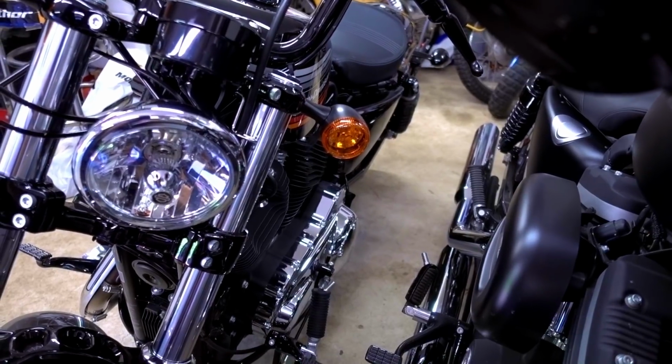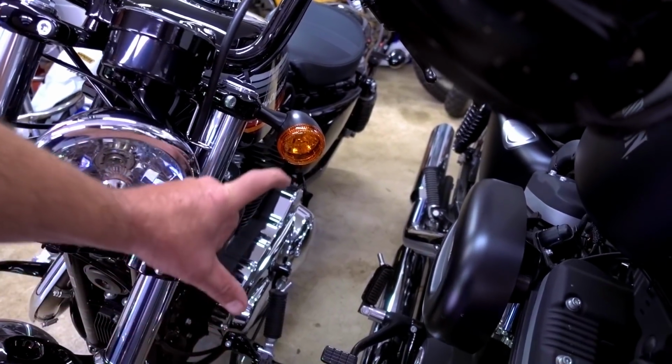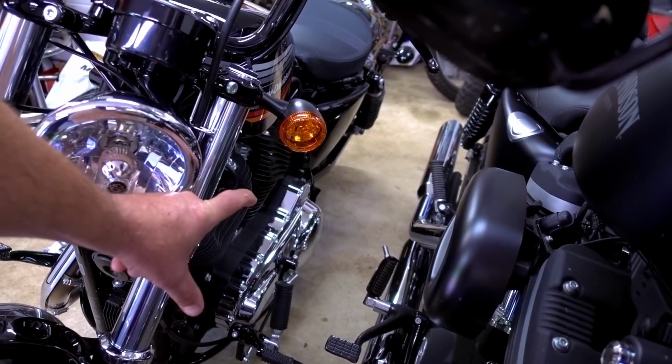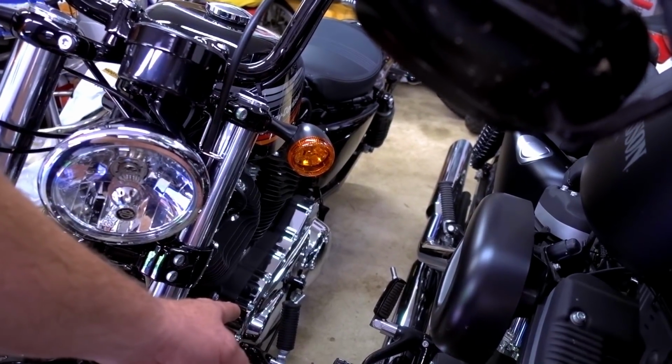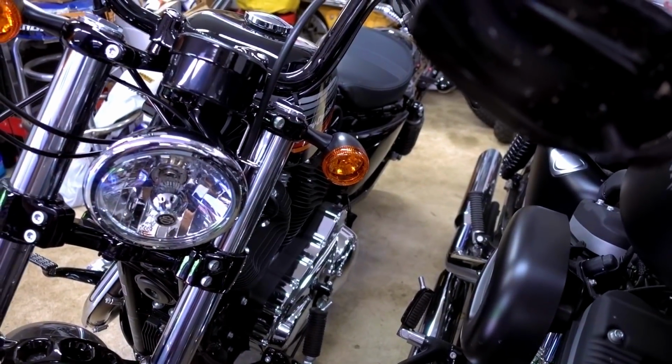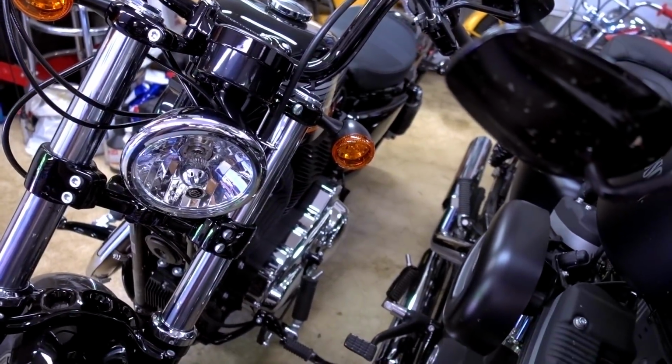You need a mondo torque wrench, though, because it's like 250 to 260 foot-pounds of torque, and a special locking tool so you don't twist the crank. Plus, you need something to hold it, otherwise you just turn the engine over forever. You'd never hold the engine still without it. It's a thing that locks between the sprockets, and you can torque it down.